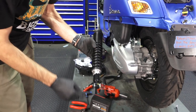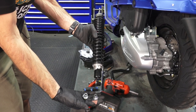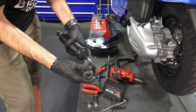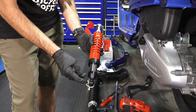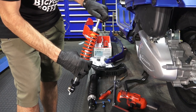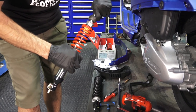The shock is slightly offset, so when you put in a stock replacement shock, make sure the offset is towards the inside of the wheel. You also have a pair of spacers — some aftermarket shocks use their own spacers depending on the setup, and oftentimes you will reuse the rubber bushing on your new shock setup. With this Bitubo setup, they have two shocks with spacers that are slightly different between the two. Use the one with the larger spacer for the left side. Put the large rubber spacer onto the shaft.